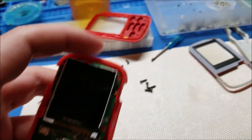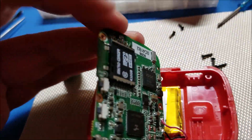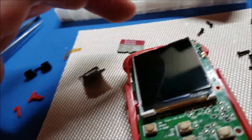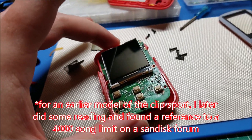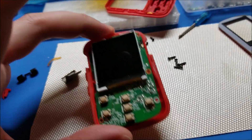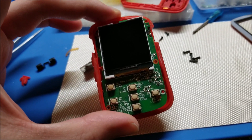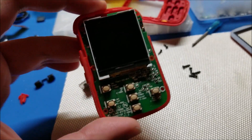Let me just shut this off for a second and show you the back of it as proof. I re-soldered the battery, clearly. You can see the Micro Center 32-gigabyte card in there. I don't know what the limit is for this player. From what I read, there was a software limit for the library which is 2,000 songs. I'm guessing there's going to be a file limit and whatnot, so you're probably not going to be able to upgrade this to something ridiculous like 128 gigabytes and actually use all of it — the player will probably crash or slow to a crawl. But 32 gigs, 64 gigs should work just fine.